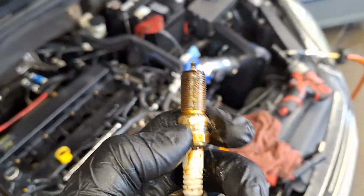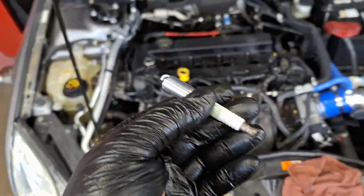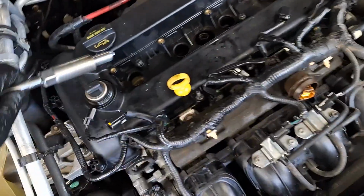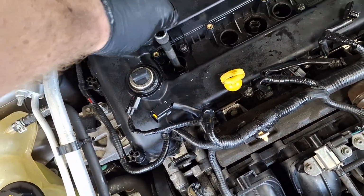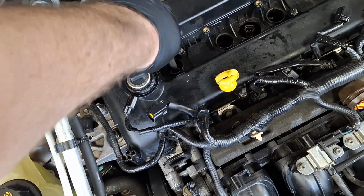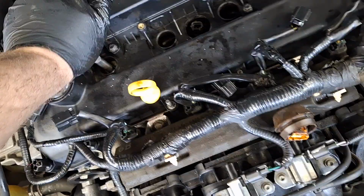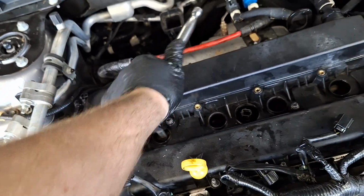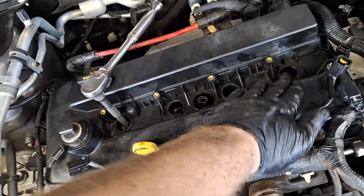At this point, I'm going to put my new plugs in. I've chosen to go with some NGKs here, not a sponsor. Put that into the socket. Always start these by hand and tighten them down by hand as well. There we go. I'm going to run that down as far as I can by hand and then snug it up with the ratchet. Just get it snug with a ratchet like this by hand. You don't have to go crazy with it. There you go. That's good enough. And repeat that for all 4 plugs.